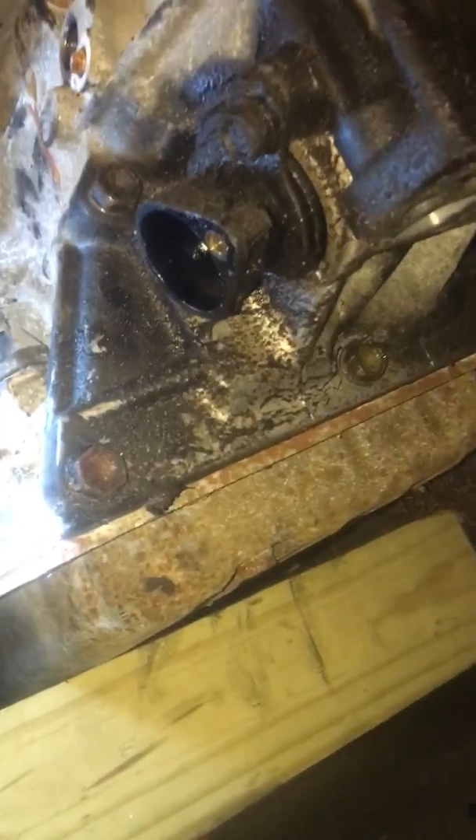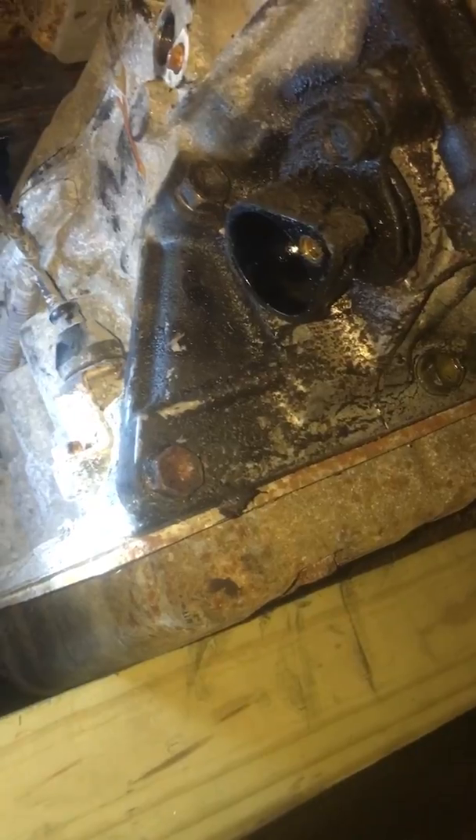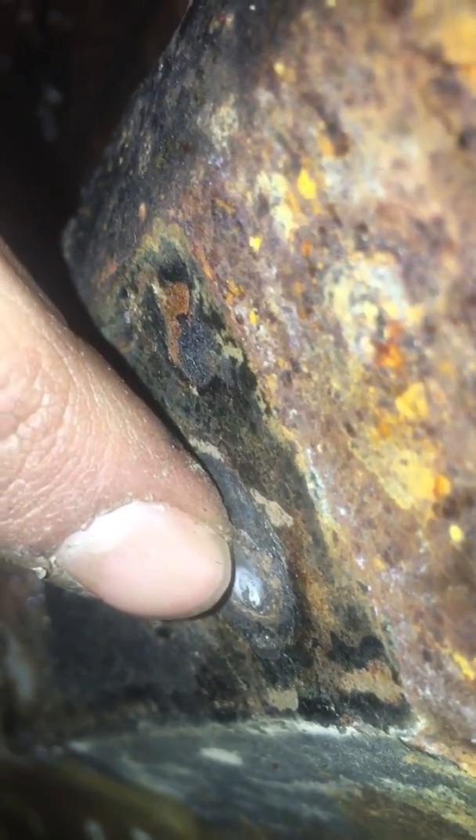I actually ripped the motor mount at the junkyard. Unfortunately there's a stud right there and that's where the bolt was — I snapped it. I only snapped this side; on the other side I was a little more careful and used some heat. So I've got three studs, and I'm pretty comfortable with three — I've done three a few times before.